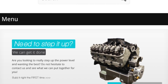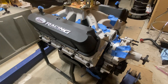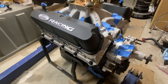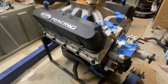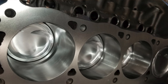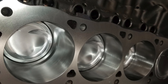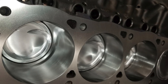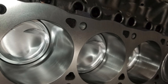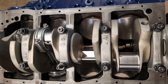When we got into the block and took the heads off, there was a little bit of water in one of the cylinders. So originally this was going to be a 408 build, but it ended up as a 414 — we had to go 60 over. People think that's going to cause overheating issues, but that's not really going to be the case. With that said, it's not a dart block, so my block is probably going to be the limiter on the build — but so be it.